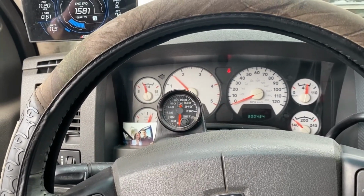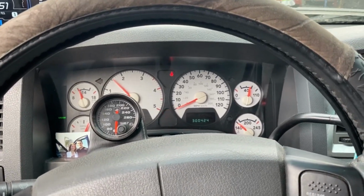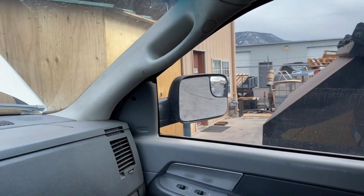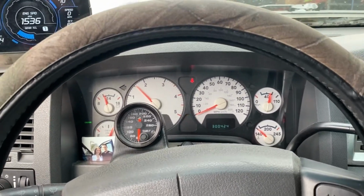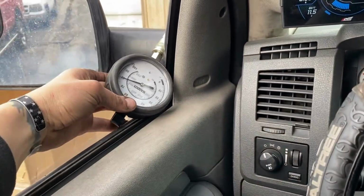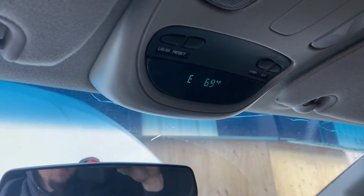Back in 10 minutes. So we're about halfway through it right now, guys. I totally forgot, we have 03, 04 injectors with a 6-7 bowl, so we gotta work on the crank timing. The early style bowls need a little bit more positive timing, which is why it's running so bad. But so far, still got good oil pressure. Everything's going smooth. We're at 110 degrees. It is pretty warm out today for spring, but I'll take it.